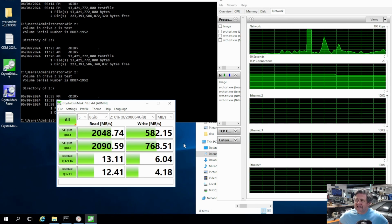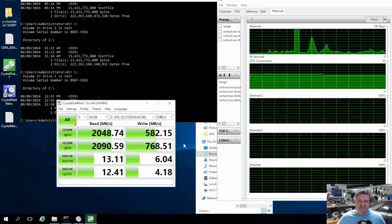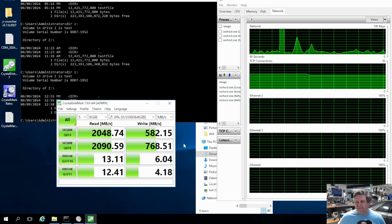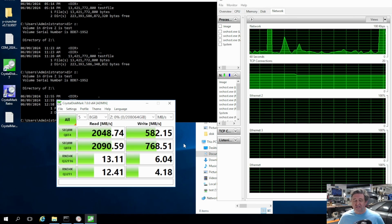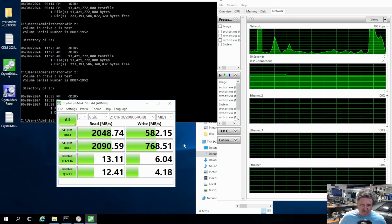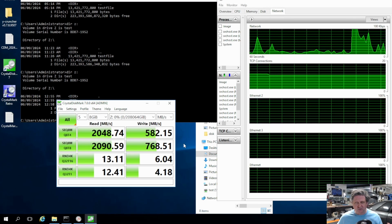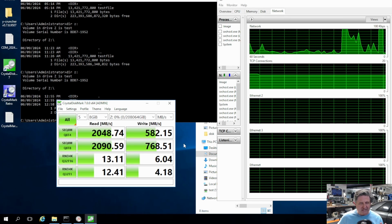But it only does it in cases where the disks fail in particular ways. I've seen some faults before where there are read-write errors that start creeping up, and it won't fail over to the spare at that point. It'll only fail when it actually faults the array. And also, once it's faulted the array, there's some tricks in configuring it. You can't really just use that one forever. You have to pull it back out and replace the original disk first inside of the zpool. Nothing magical or science, but it is an interesting thing in that it isn't as super easy as you might expect it to be.